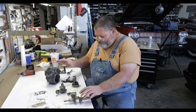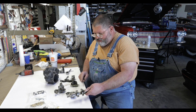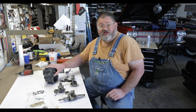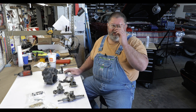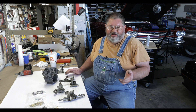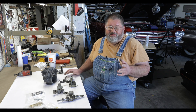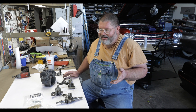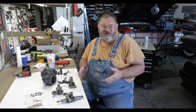So this is all going to be put back in — I'm going to machine a shaft that's just straight through, and it's going to be mounted on the engine. It'll all look like it works, but it will do nothing. We're going to have a small electrically powered air compressor mounted in the trunk that will have a pressure switch — it'll pump up its tank and maintain it at around 150 pounds. I'm looking at moving away from the high-pressure tank on the firewall.